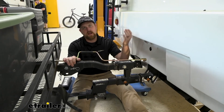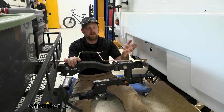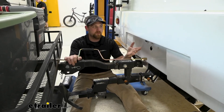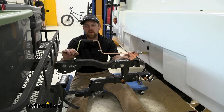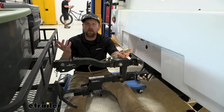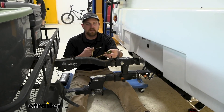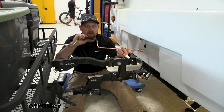To talk about how to actually operate the spare tire winch: you put that adapter tube onto it, cotter pin it, and that's going to run back to where you're trying to access it. In our case, the only thing I could do was put it behind the license plate — I drilled a hole. Just like how you would do it with your car, you take your spare tire tool, put it in there, and rotate it. If you had a four-way tire iron or even just a large socket set, all this is, is a three-quarter inch six-point socket essentially welded onto the rod.